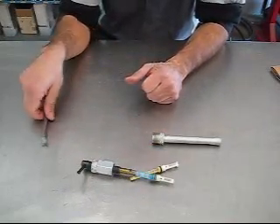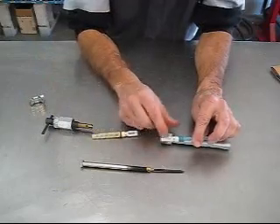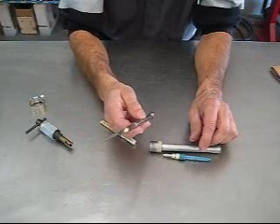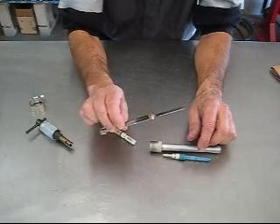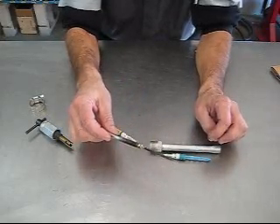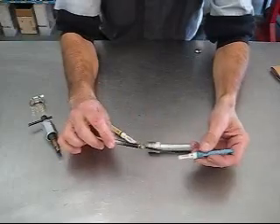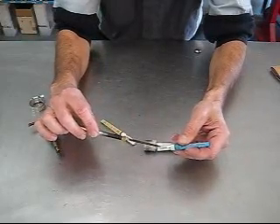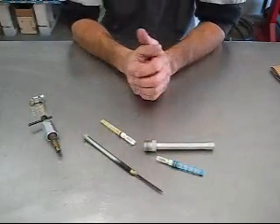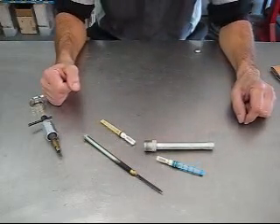When all else fails — in other words, somebody has put the tube in too far and you can't get it out, or it's just really stuck in there — a homemade orifice tube extractor can be your best friend. All that is is a drywall screw brazed to a bolt, or you could use a really long drywall screw. You'll probably have to break away some of the screen, but you can go down and actually puncture into the brass orifice. It will lock in tightly and really allow you to tug on that and get it out. In our shop, there's rarely been an orifice tube we haven't been able to get out.